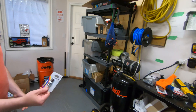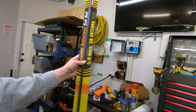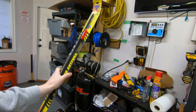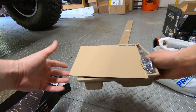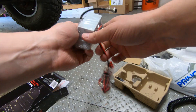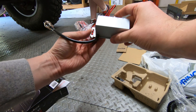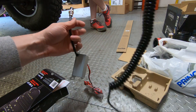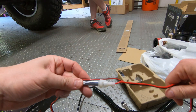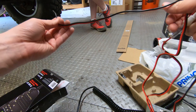We've got a stud that connects the cable up, and a 36-inch fire stick, which is basically a pretty standard CB antenna. I've never installed one of these radios before — I did install a VHF radio in my Jeep and it wasn't too bad. Basically I just need to get power to this little box, mount it, connect the microphone, and that's all there is to this unit. It's pretty basic, very simple, just how we want it. This came with a little inline fuse.